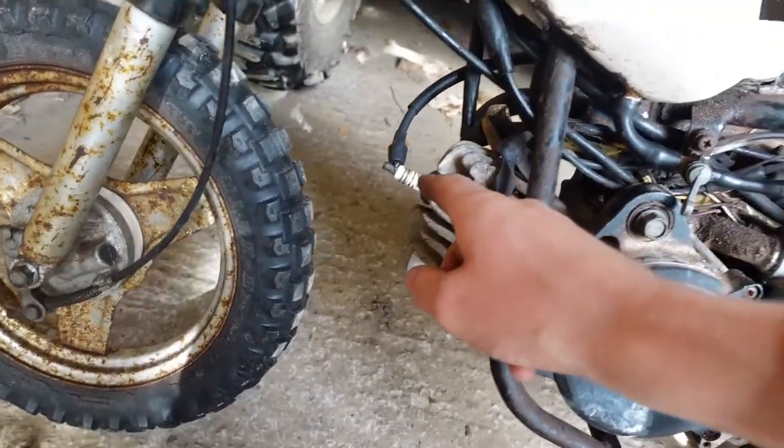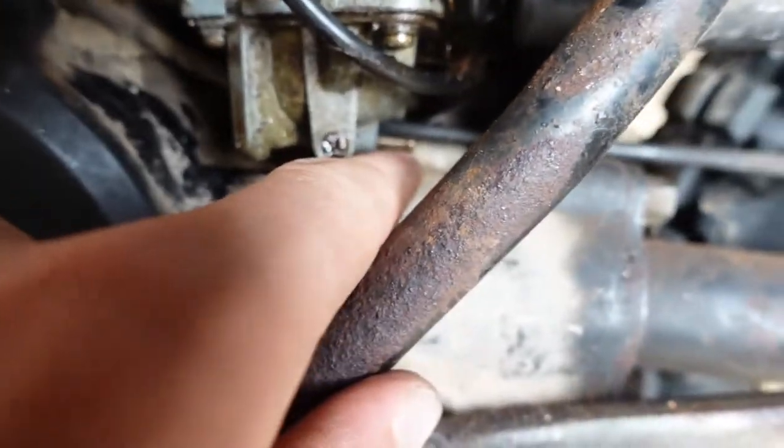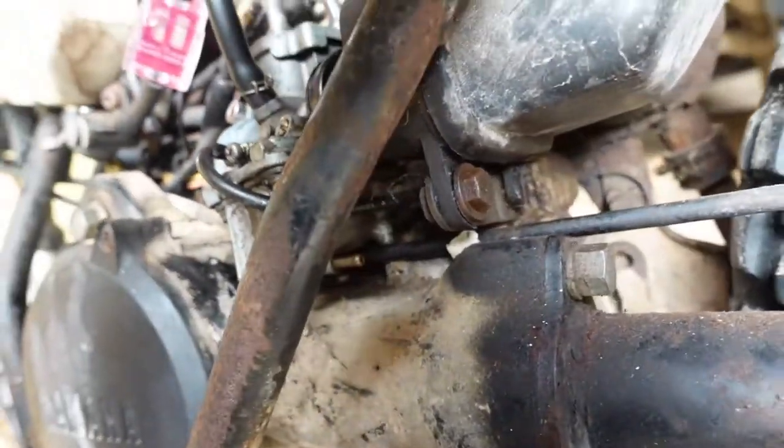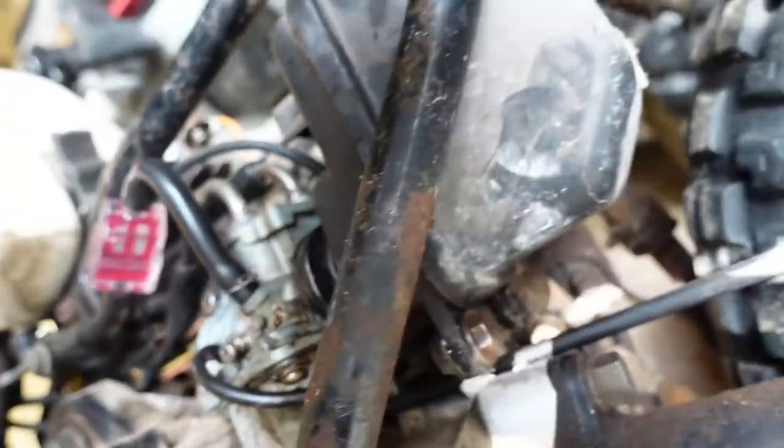It gets even worse — we thought the fuel leak was fixed and it is fixed in that spot, but if we run down here there's a tube completely missing. I don't know how long that's been missing but it's just dripping out of there. I don't know how I'm going to repair this honestly — I'm going to have to watch videos online and maybe order some other stuff for it. This is such a complicated little thing. If you guys can give me a hand, I'll put links in the comments for things I need to buy. The thing is dripping from everywhere now — there are a million fuel leaks on it. It was going really well until I found another fuel leak and the broken spark plug. This is going to have to be a project for another day since I don't have the parts for it.